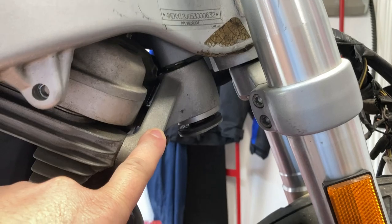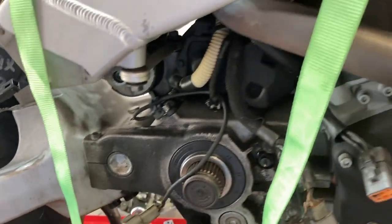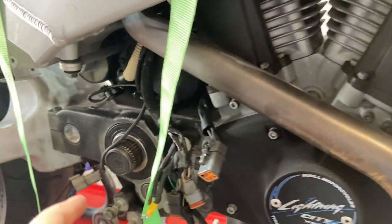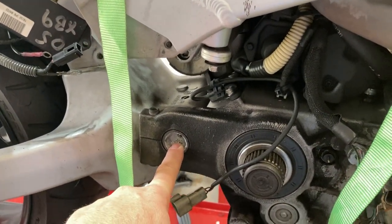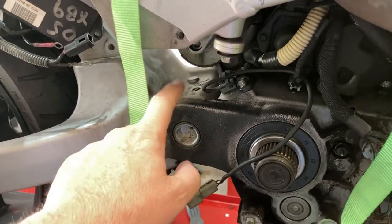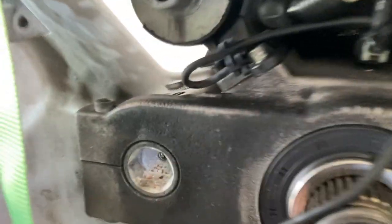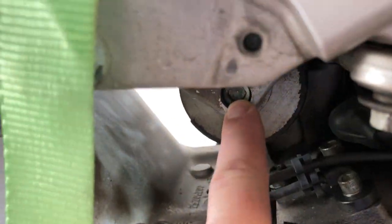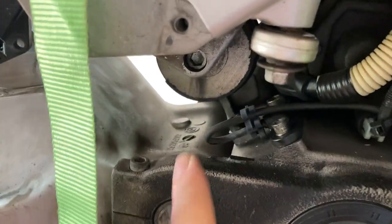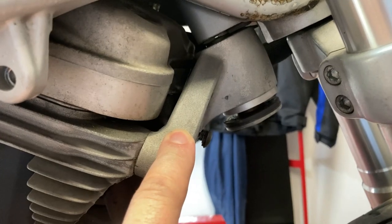So here, and here, and here — and maybe there — are what are keeping the bike in the frame. I question this one a little bit, but there is going to be at least some stress to the suspension there. I forgot about the isolator, so there's that too. We should be okay to remove this, and then leave the rear isolator and the front isolator connected.